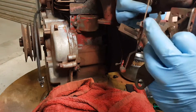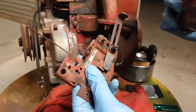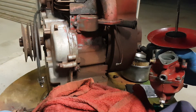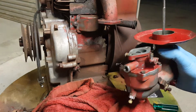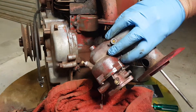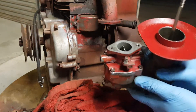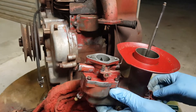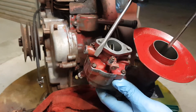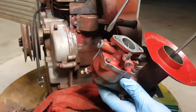If you have a look on the back, you can see there's our throttle rod — a little bit of manipulation and out it comes. Let's put that over here and drain a bit of excess fuel. Now again, this is where our flathead comes in handy on these four bolts here. These are not tight as I did them up just because I wanted to put it back together for this video.